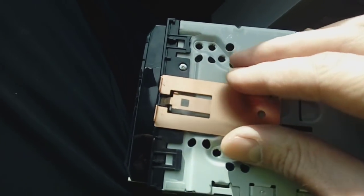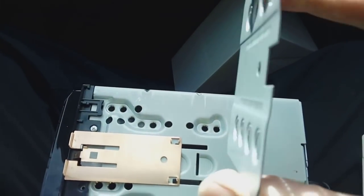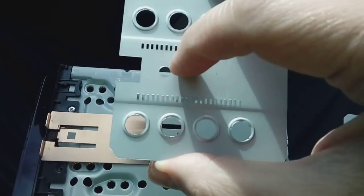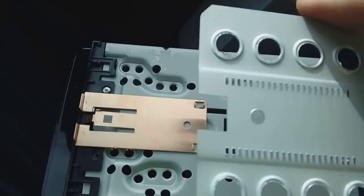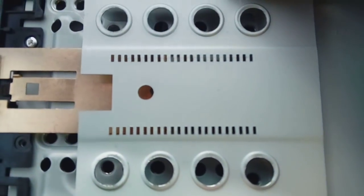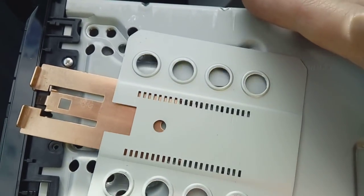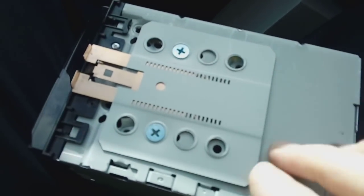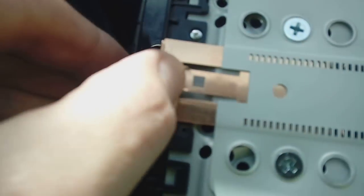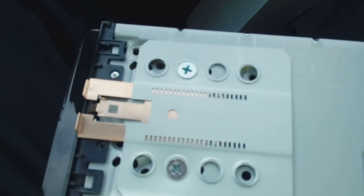The plates have a bump in them — you want that raised to the top. There are locating dowels on the brass pieces that go top and bottom into a ratchety system with holes, so line up the screw holes and the indents. Then choose your screw holes and fix it on. Two screws, one each side — the little ratchet clips pop through, so it won't move anywhere. This is the security locking mechanism so the new stereo clicks into place like your old one.